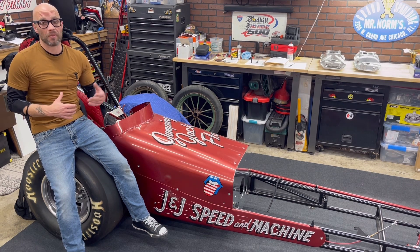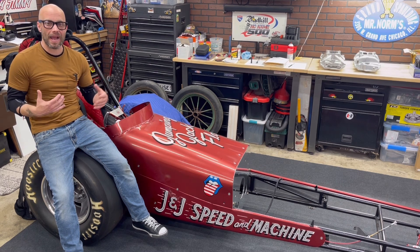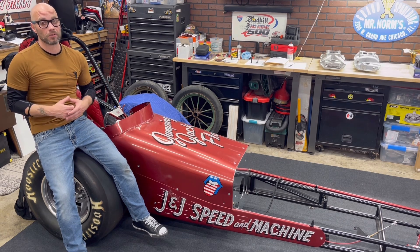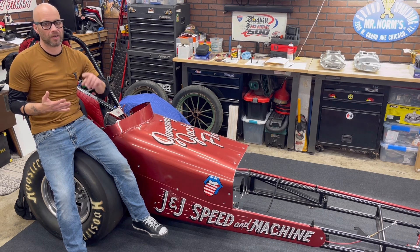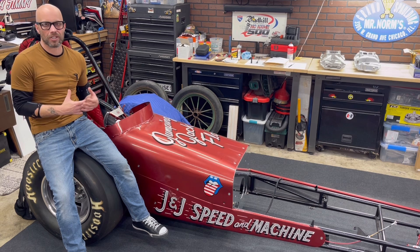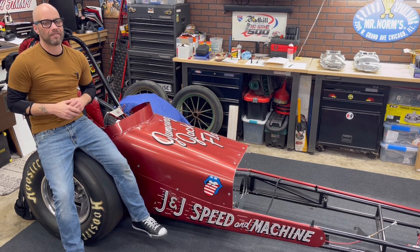That's a high level discussion on the differences between a single plane and a dual plane intake manifold — their different characteristics, some pros and cons, and how they can be incorporated into your build. You really want to make sure when designing your engine, it's an overall package. It's not just putting a single plane intake manifold onto an engine and expecting good results — in fact, a lot of moderately built or mild engines, if you were to put a single plane intake manifold on there, you would probably lose power. Match all your components: camshaft design, gearing, torque converter, carburetor, cylinder heads, and compression. In my case, I like to really get on it and tinker and tune, so I do choose a lot of single plane intake manifolds. The reason I'm going with the Holley dual plane high rise is it's going on a special engine that's really going to take advantage of that design.